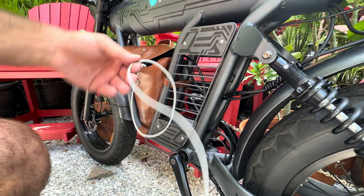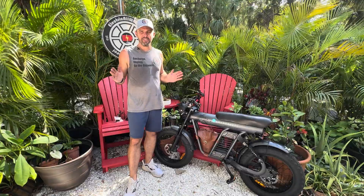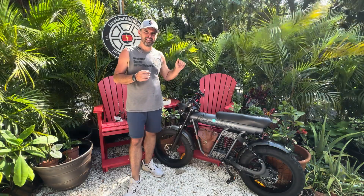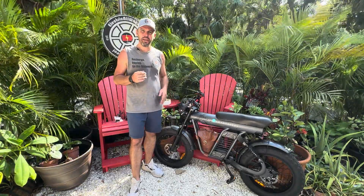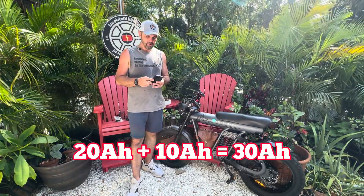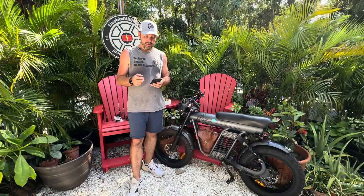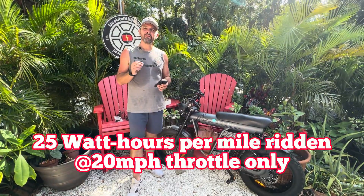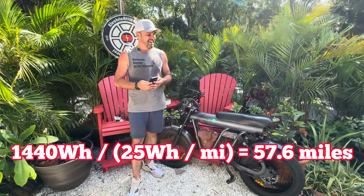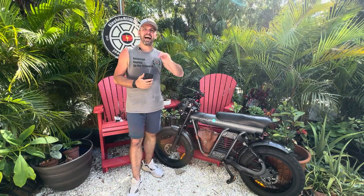And then you have — well, this is an iPhone — but you have a USB charging cable for some of your accessories. There you have it. We have successfully done a dual battery install on this TravelSmart 48-volt, 1200-watt rear hub with a 20-amp-hour factory battery. We have added the second 48-volt, 10-amp-hour battery. For range calculations: 20 plus 10 equals 30, times 48, gives you 1,440 watt-hours. Divide that by 25, which is the Micah Toll Constant — 25 watt-hours per mile ridden at 20 miles an hour throttle only — and you get 57.6 miles. This thing is a beast. It rolls out at over 28 miles an hour, so it's definitely worthwhile to have a second battery to get this thing the distance you want to go.